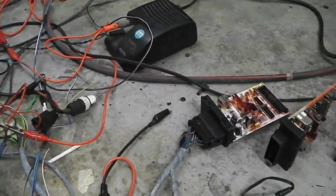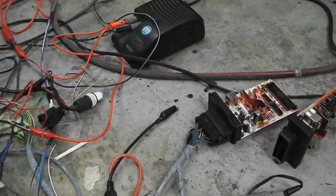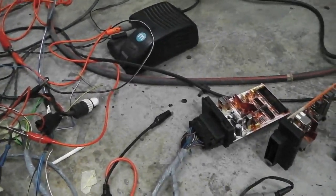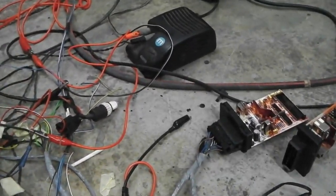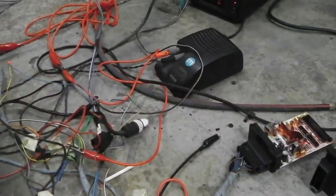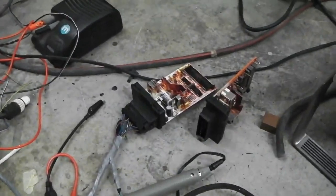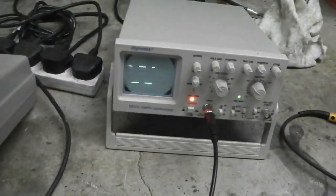It's not going to be trying to lock onto a speed, because you've got to have the road wheels on really to create a rolling momentum. Otherwise, as soon as the revs drop off, the speed sensor will instantly drop down with it, when normally that wouldn't happen. The momentum of your car would be rolling, keeping a steady speed, even though the accelerator's dropped off. The momentum of the car itself is needed to test this, so there's only one way to really test it, and that's on the road. However, we can get 90% of the way there by testing the throttle system using this to simulate the speed.